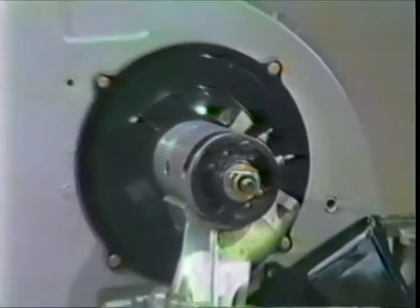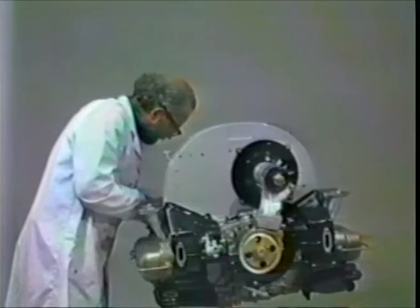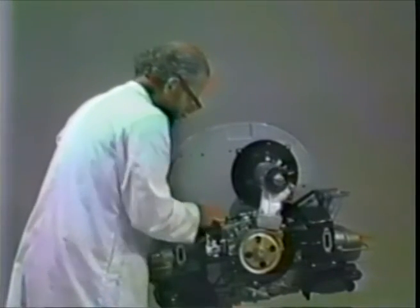So we'll get out some K-Rows. That seems to be the brand of choice here these days. And put 4 of them on both front and back. There's another K-Row, like so. I like to use new 6mm washers. When you use all of them new, they really make for a nice combination. You put on the bolts loosely first. Just screw them in hand tight.